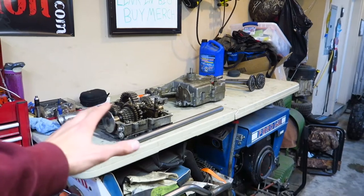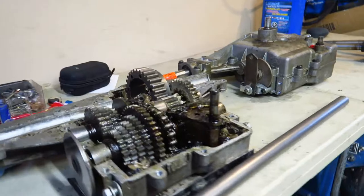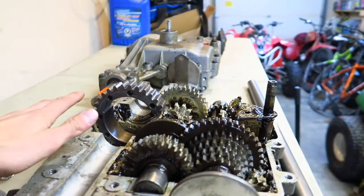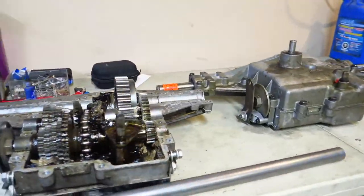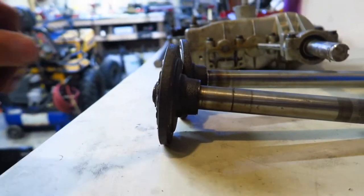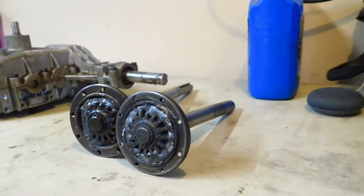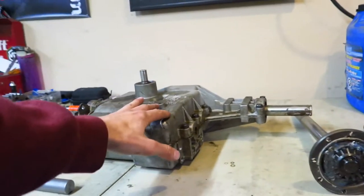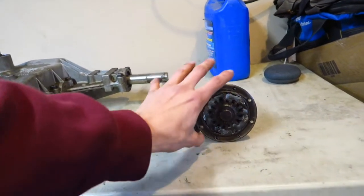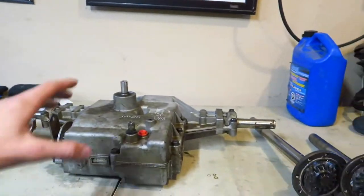Since Tony's getting a little more rowdy on his mower, we're going to be installing this one inch axle shaft. We need this gear to sit perfectly on its axis point so that we don't have any stress going in places we don't want it — that's what these little hub flanges do. I'm going to open up this diff, take out the two flanges and axle shafts, and install the new ones.